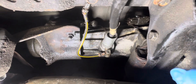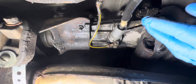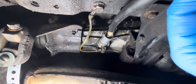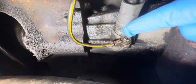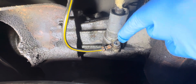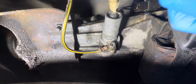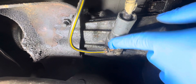Underneath the car here — trying to film this over my head — this is towards the back of the transmission, filming from the passenger side. Here's the speedometer cable that comes from the passenger side I was talking about earlier, and it runs into what they call the pinion gear, which meshes with the transmission. As the transmission is turning, it turns this pinion gear, which turns the little spline inside the speedometer cable and reads the speed.